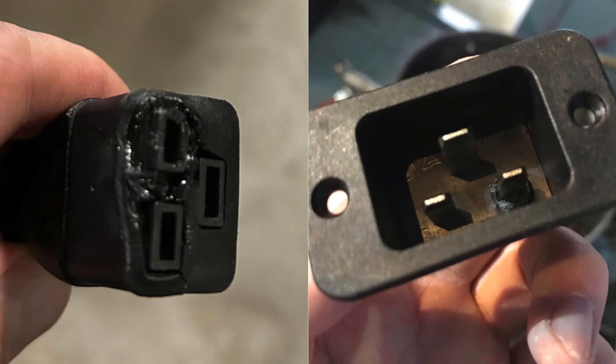It is very important to make sure that your cables and plugs are bone dry before use. Some home brewers have been discovered to finish a brew, do a clean, and then add the power cables into the brewing system and add the lid. Moisture is then still trapped inside and can compromise the cables, leading to electrical problems — especially if moisture is caught within the terminal cutouts of a cable, like the one shown on the left of your screen now. It is far better to have the pair of cables stored on top of the unit's lid than inside.